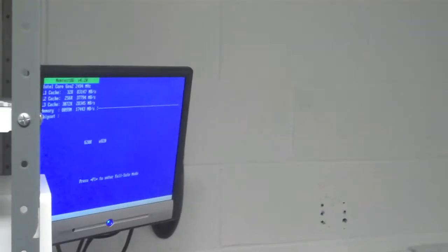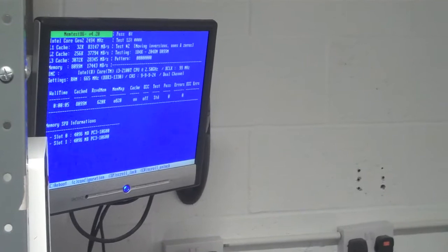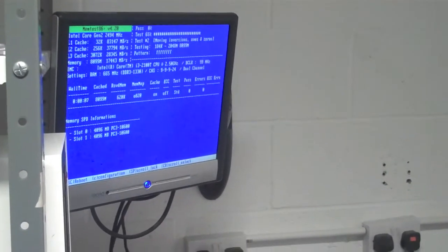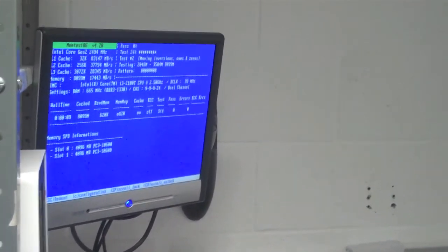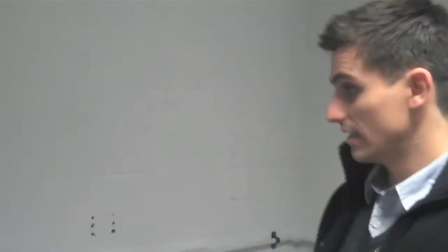After the overall visual inspection, we will go through the memory test. We will test that the memory modules inside the unit are fine, and then we're going to flash the BIOS with the custom BIOS for that particular type of unit. This has just started the RAM test. This will take up to 10 minutes, depending on the size of the RAM inside. This being an 8 GB unit, it will take up to 5-10 minutes. When we do get any errors, they will come up with red flags here, but hopefully this one won't have anything like that. And that's basically it for the sample test.